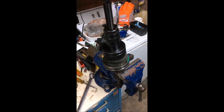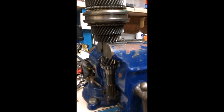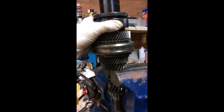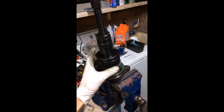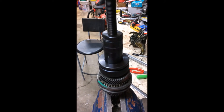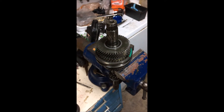You can see I was starting to raise the bearing off the shaft. This is like the outside cage of the part. There are four devices in here that, when you screw this inner portion of the tool down, it expands those into the bearing so it grabs the bearing. This screws onto this portion of the tool, and then this puts pressure against the input shaft, which pulls this up and releases the bearing off the shaft. It works pretty good, but like I said you can use a generic bearing puller on a press - that's what I used to use, it works just as good.